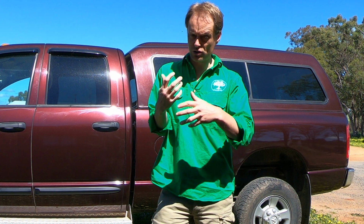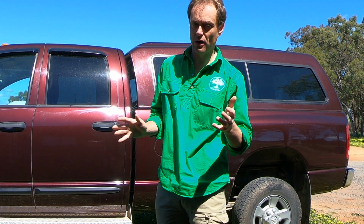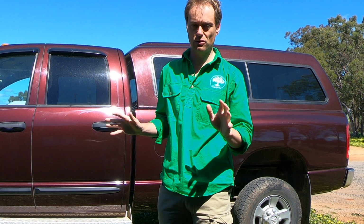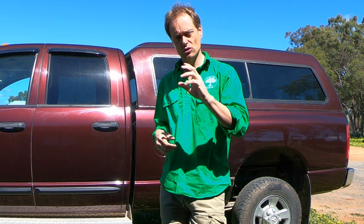The thing you want to know about it is that a lot of trucks, certainly in this truck, but not just limited to this truck, there is a transmission fluid temperature sensor in the pan already, and it has an alert value. So if the transmission fluid goes over a certain temperature rating, you'll throw a warning light on your dash, and then you'll have to decide what you're going to do with that, if anything. Probably a good idea to back it off or to pull over or whatever, but anyway, it's going to throw a warning light.